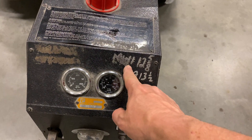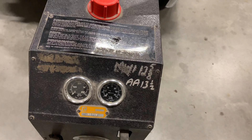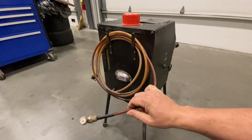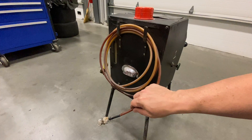You can see here I have ride heights — I'll show you how to use those later. The Mini is 12 and 5/8 inches and the Austin America is 13 and a half. On the back side of the unit are two hoses: one is black, one is yellow. The yellow is the vacuum side and the black is the pressurized side.